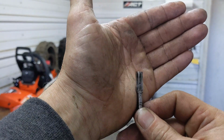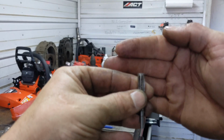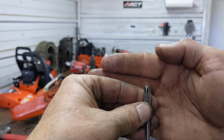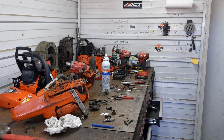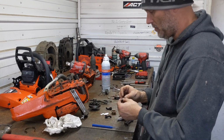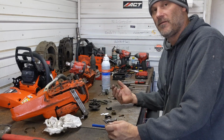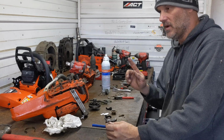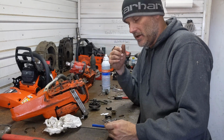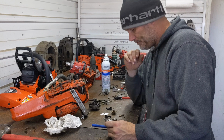What we are going to do is change that taper to be a little more extreme. We're going to leave the high side alone, and then we're going to bring down this ever so slightly. Now, more is not better when it comes to this. You can overdo it. These pistons are designed to set inside the cylinder at a certain point, and it takes very little. The throw on this one is stock 0.45 millimeters displacement and movement left and right. We're going to shoot for about 15% more capacity, which would put us at 0.5 millimeters throw in and out as it goes.